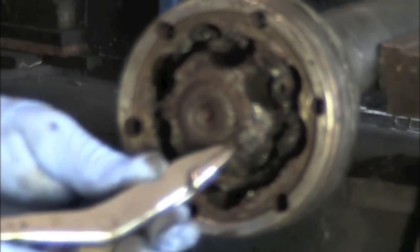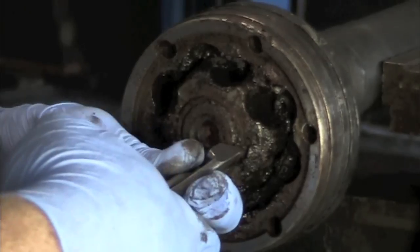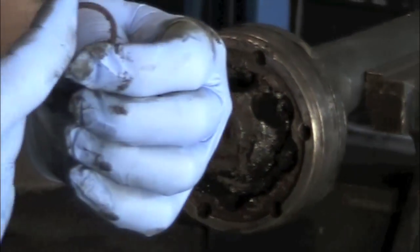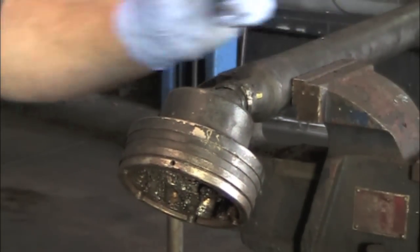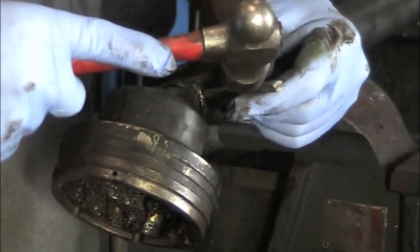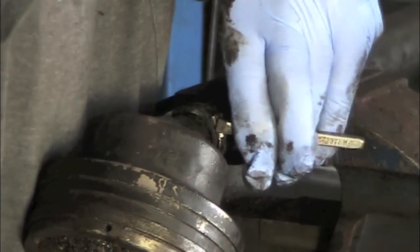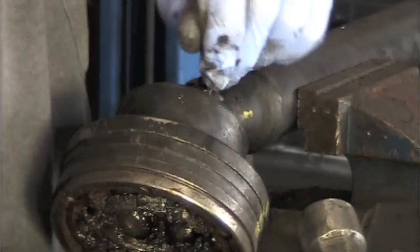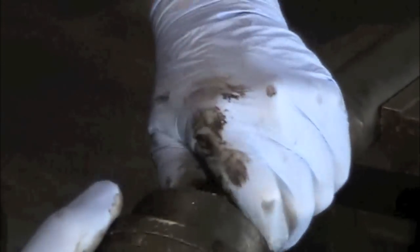There's a clip out here on this edge. Sometimes they're a little bit difficult to deal with. You can pop that clip off — it's got an open end here. You use specialty-type pliers that get up in here and spread that. There's also another band clip in the back of this. Once you get it opened up a little bit, slot that assembly off.